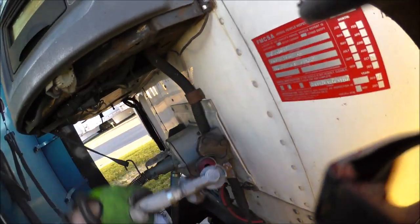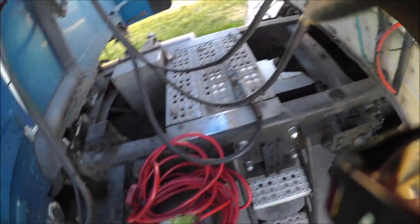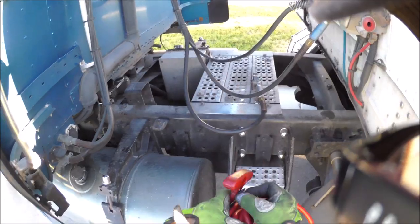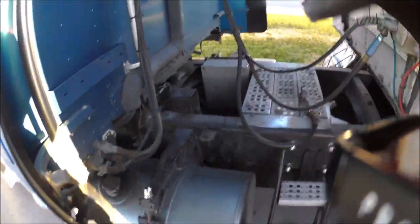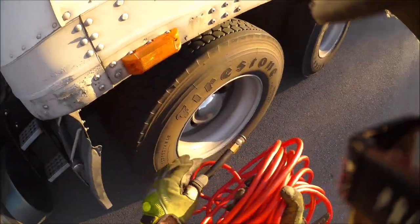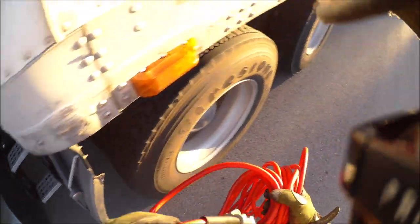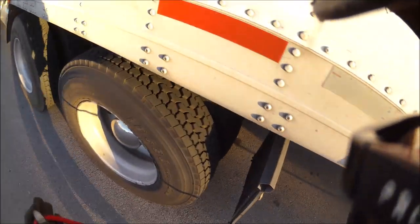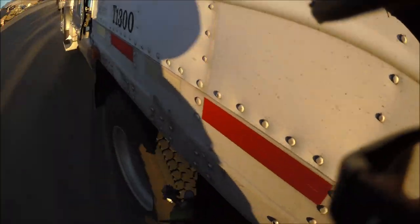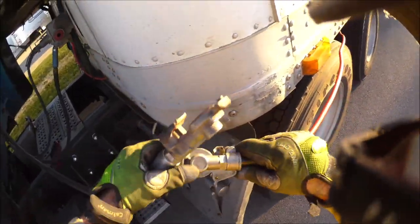There's a glad hand here - there's an emergency line that supplies everything. It's your red. When you push on the brake pedal that will be your blue. It's good to have your air hoses all set up when it comes to this emergency stuff. It catches all the way in the back - you pretty well have to spool it out underneath the trailer to get to this corner, and then wrap it underneath the trailer to get out of everybody's way. You hook up these glad hands this way.